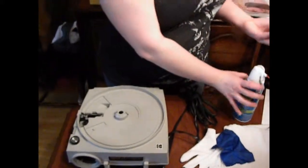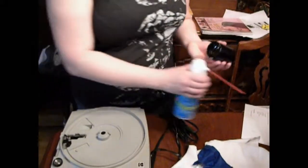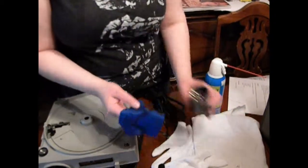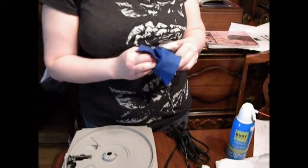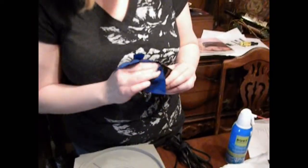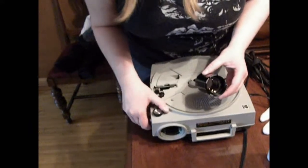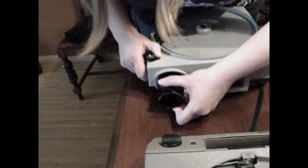And then wipe with the dry end of the cotton swab. Next, take the compressed air and spray the lens. Then squirt lens cleaner onto the tissue and wipe the lens down, then wipe dry with the dry part of the tissue. Replace the lens by pushing the focusing knob to the right, lining it up and sliding it back into place.